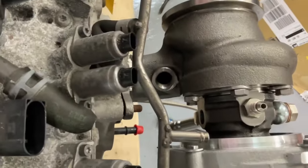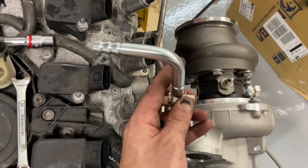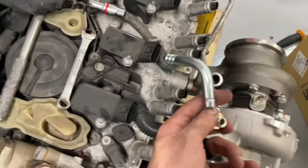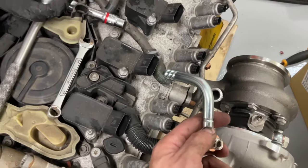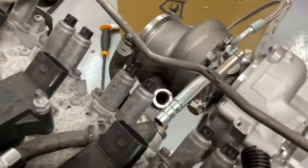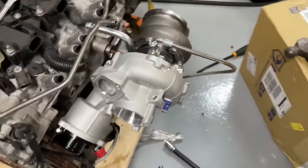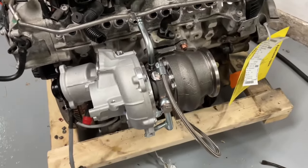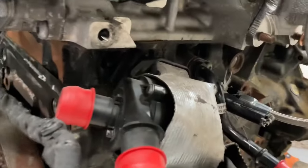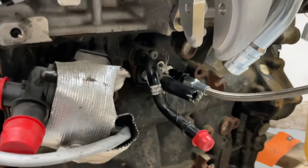Coming around to the front side again — this is where the front coolant line goes, with another bolt and two copper washers. It sits on just like that and connects to that hose right there. I can't connect this one since the LKQ cut the hose, but I'll get a new piece for the final install. There you have it — that is how everything should look when you're done installing. I hope doing this outside the car made it easier to see and understand how these fittings go: your oil feed, coolant feed, and return, down to your filter and feed line.